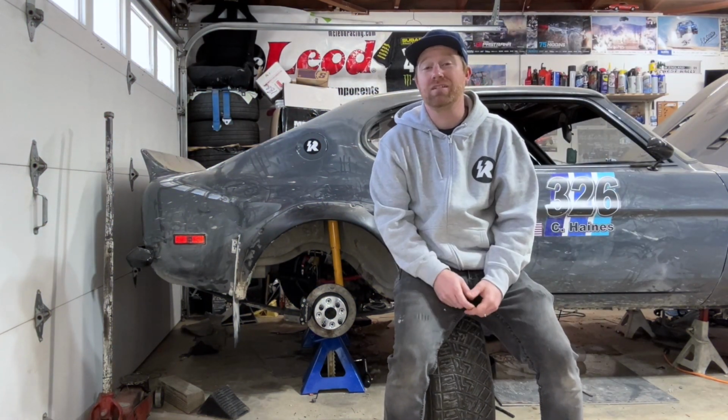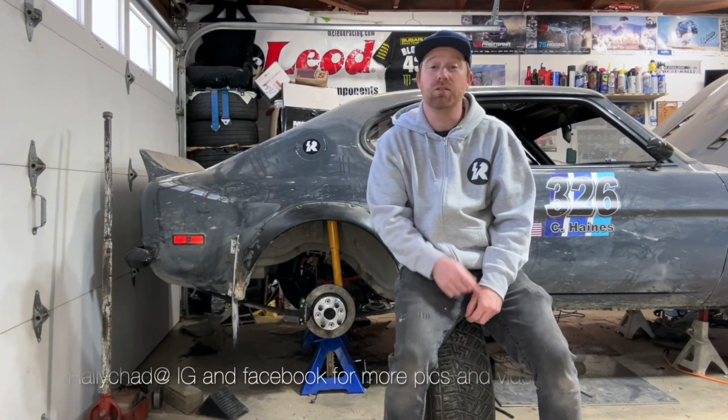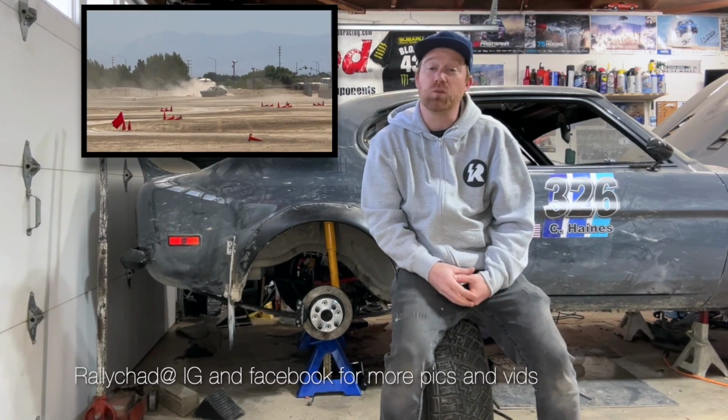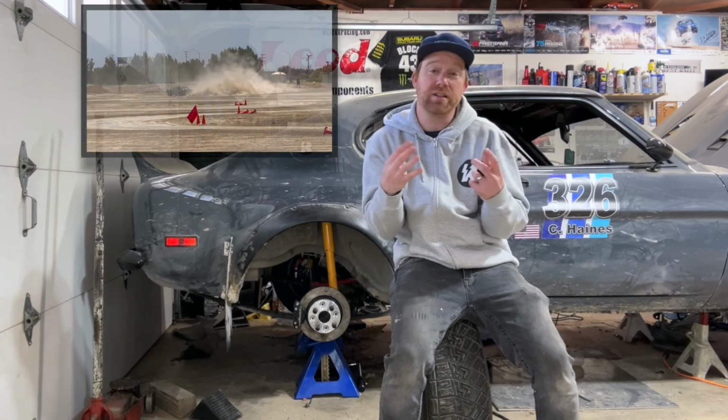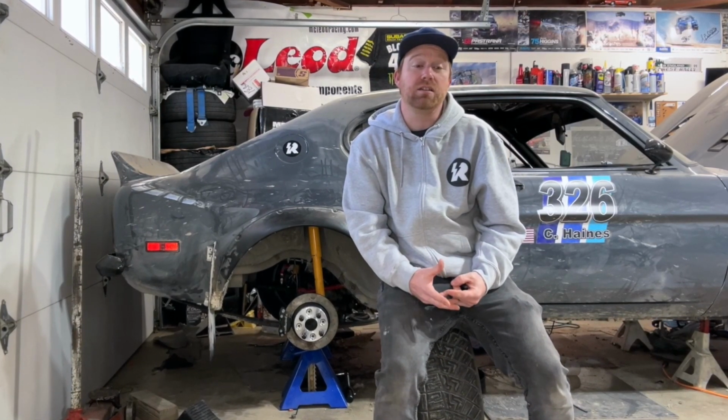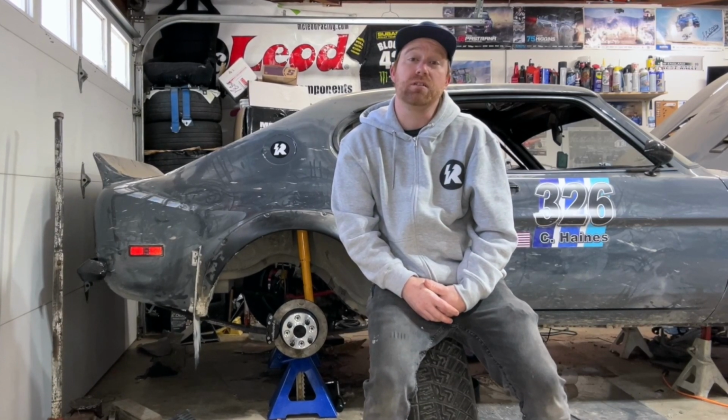Alright, so the road we had to travel to get to where we are right now for doing the pedal box is we did the rallycross, and in the rallycross I thought my brake cylinders were leaking in the back because this only had drum brakes at the time. I just wanted to get out there, get sideways, have fun with it, and then make revisions to the car afterwards. So I noticed that some fluid was showing up on the inside of the wheels after the rallycross. Lo and behold, it was the bearings for the rear axle.